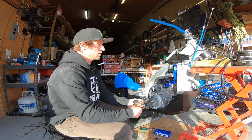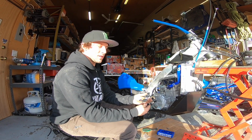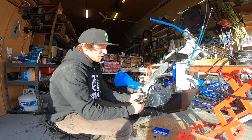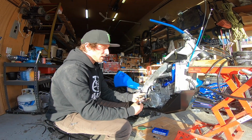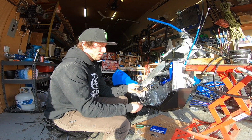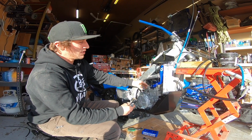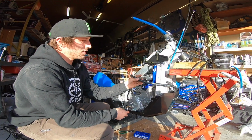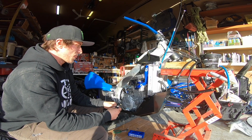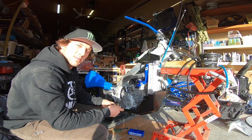So with the Selkirk system and the C3 system, using 2 different systems, they have ways of doing their coolant routing. It involves a lot of extra parts, and some cutting of coolant lines, and I have my own way that I want to do. We're going to take some parts out of these. We're going to use the C3 lines. We're going to use the Selkirk skid plate heat exchanger, and hopefully I can explain it well enough so you can follow along, and I'll show you what I'm doing.